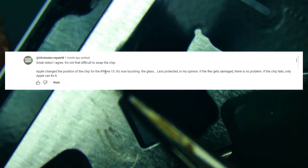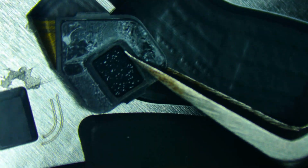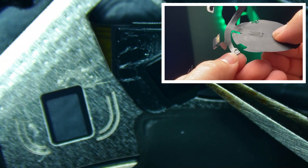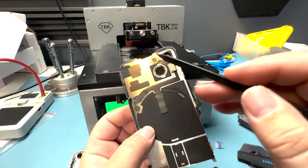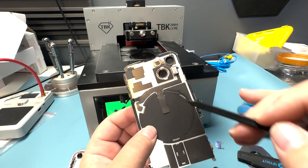Taking a look here at the back of the phone, if we carefully pry under this flex cable, there's some adhesive that wraps around in a U shape. The chip is about the same thickness as the metal shield that surrounds it. You can make out that it says 3304. One of the things you'll notice is there's underfill surrounding this chip, completely making it different from the iPhone 14 and 14 Plus. Not only is it on the back side, but it's got underfill, making this a really awkward one. I'm glad we don't have to transfer it over, or transfer the entire flex. This whole unit can be transferred by taking off the screw, the brackets, carefully heating it up, and carefully peeling up this entire sticker.